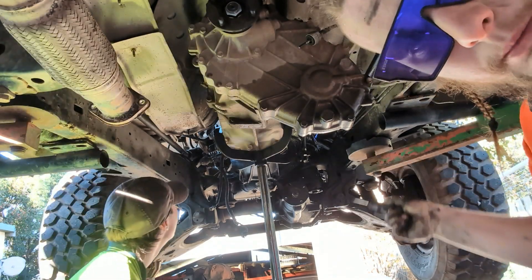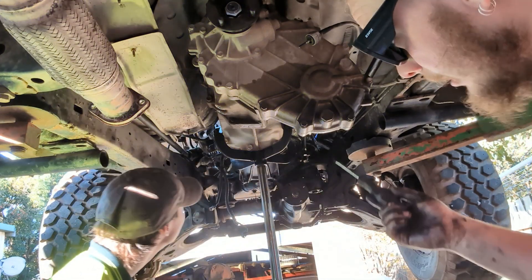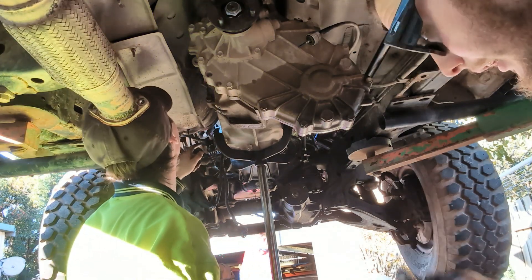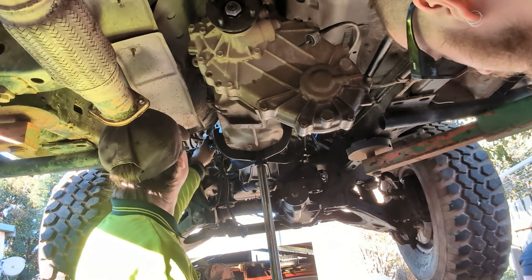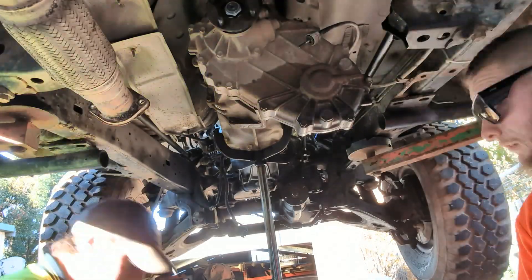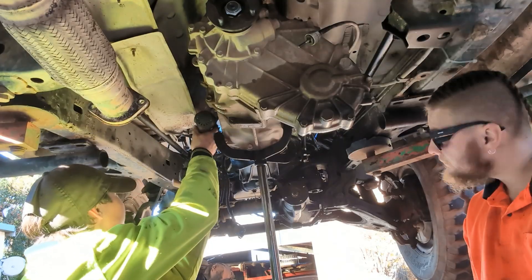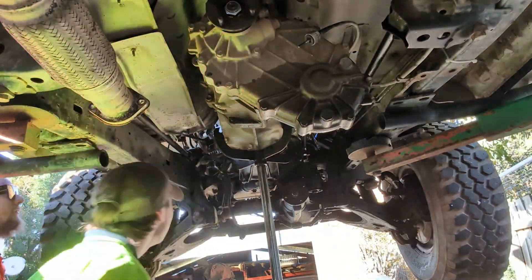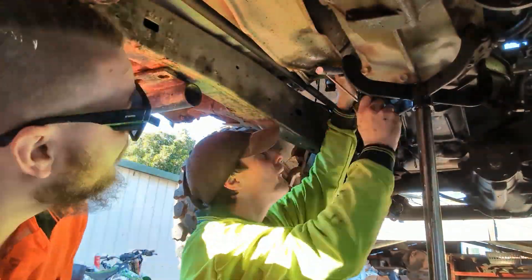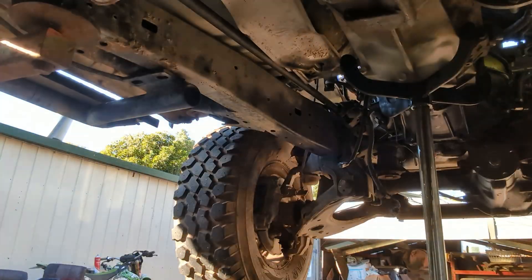As I said earlier, we're missing some of the bolts on the side, so I'm going to have to go get some more. I'm also going to get some degreaser — while this gearbox is out I'm going to do a deep clean under here as well. As you can see, we're removing the remainder of the bolts. In total there should have been ten bolts, but there were only five remaining. As I explained earlier, somehow we lost our bolts, and that's what caused all the damage on the clutch and whatnot.